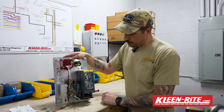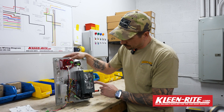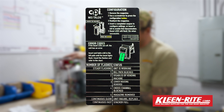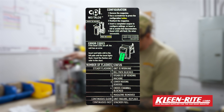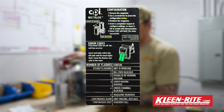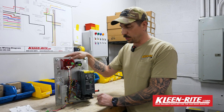Anything that's going on with this unit, you're going to be able to check the back of the bill stacker. You can see the number of flashes and status — status is telling you what state the unit is in, whether it's been disabled or if the bill path is blocked. A steady flashing means the unit is in working order. Continuous flashing when you're not in program mode means that the bill stacker is full, and that's what everybody wants to see.